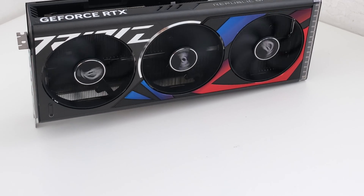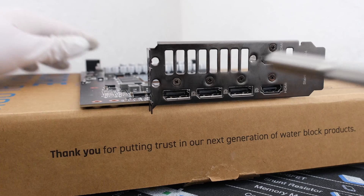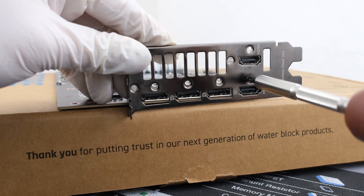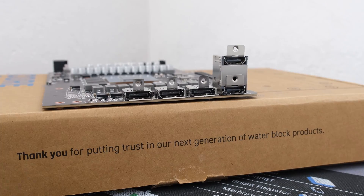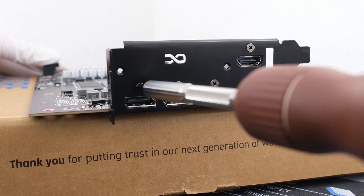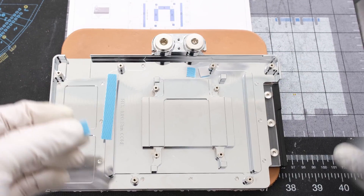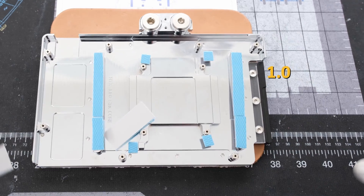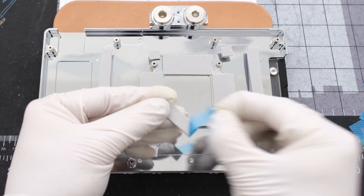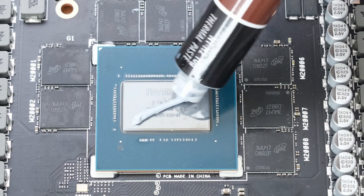On this channel, we previously did a tear-down of the ROG Strix RTX 4080 Super OC — link in the description. The stock I/O bracket is removed by first removing five Phillips-head screws, and then we can secure the AlphaCool I/O bracket with the same five screws. Since we are reusing this water block, the pre-cut stock thermal pads were discarded. So let's cut new thermal pads to size to cover the memory and VRMs. These are all 1mm thick thermal pads.